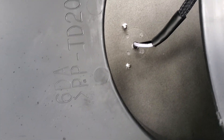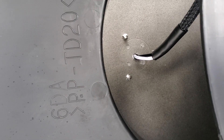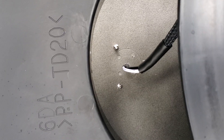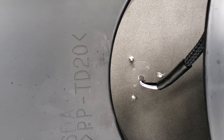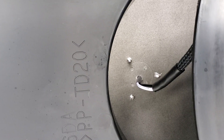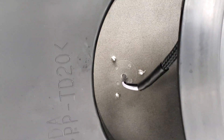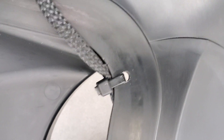What I did is I centered it up and drilled a pilot hole with a 1/32nd inch bit outward, put tape on it from the inside, then taped the outside with 3M masking tape, and drilled the hole coming in — I used a quarter inch bit. I pre-drilled the holes for each stainless screw, then zip tied it here and drilled a hole for the zip tie.